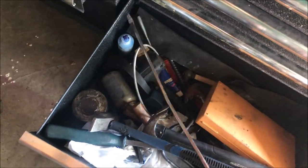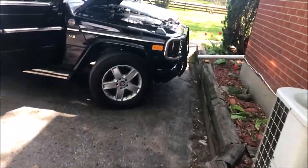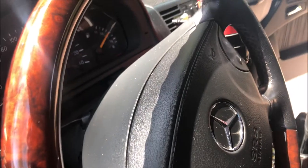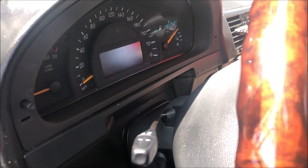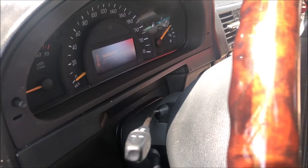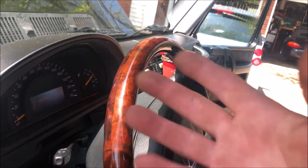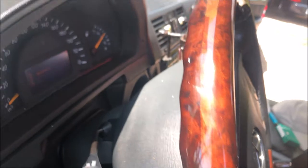So we're pretty sure it is the alternator voltage regulator. I will pull out the battery and charge it just to test it as well, and I'll show you that in a few minutes. First I'm going to check the warning light — considering it was only 10-11 volts it should still show the warning, which it does. No overheating, so nothing there. Possibility of the secondary cooling fans coming on and putting too much load on the alternator and battery — but it's not coming on, so let's shut this off.